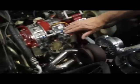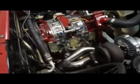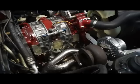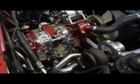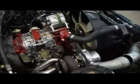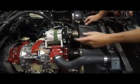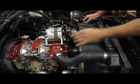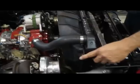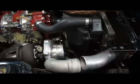On the third, we're going to run a third gen upper intake because it works really, really well. Could have used a turbo II, could have used any one of them, but I like the third gen. It makes real good power, excellent drivability. The only issue is that it puts the throttle body facing in this direction, instead of like the old GSLSEs that came over the top and back on this side, or your Series 4 engines. That being the case, you'd have to run both your charge lines from turbo to the intercooler and back on this side. In this application, we've got to go across the intercooler and come back around this way.